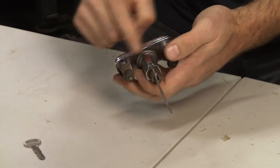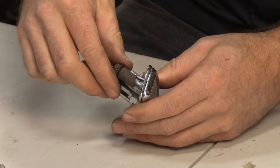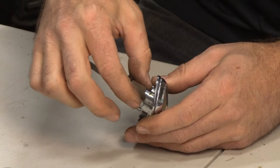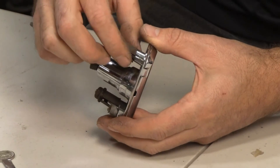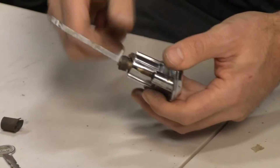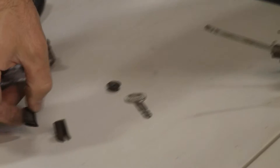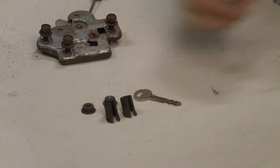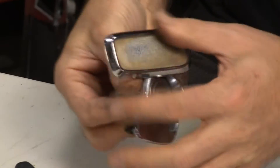Now, you may want to change your housing — that is why you need a key. By the way, when we were ramming our socket against this captured washer, we were forcing the deck lock assembly out of the trunk, and in so doing, this wedge spacer gets knocked out. So instead of trying to pry this assembly out, give it a whack from behind with that nut still on. These wedge spacers are very hard to come by — we do have them on our website.